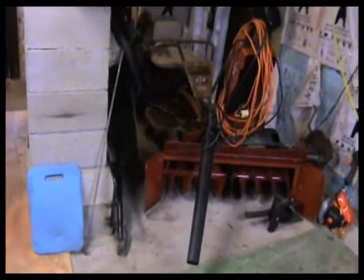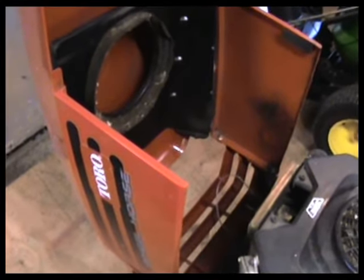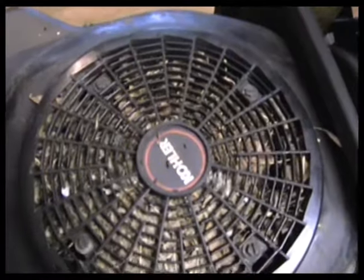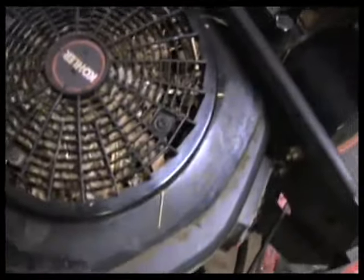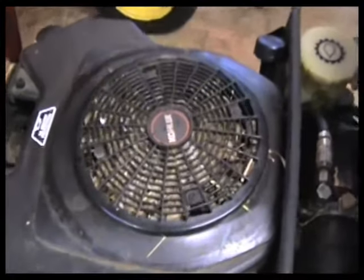I think we're going to take the hood off the Wheel Horse and set that aside so it doesn't get busted any worse, and we'll see what we can do about putting it back together. We need to get this thing running. With the hood off the carburetor will be a lot more accessible — this is a V-twin. The biggest thing is we've got to take the covers off and see what our friendly mouse has done in there. Mice just love to move into these things. We cleaned a mouse nest out of the other one and now we've got this one to deal with too — they did sit in a hay barn, so understandable.